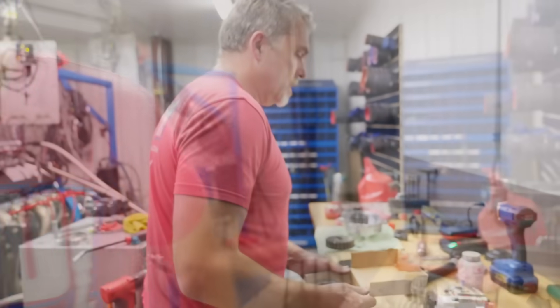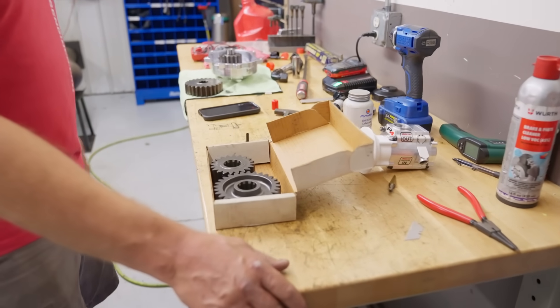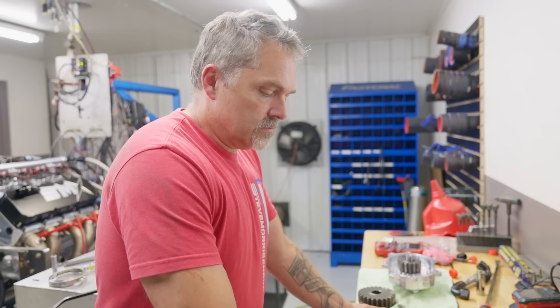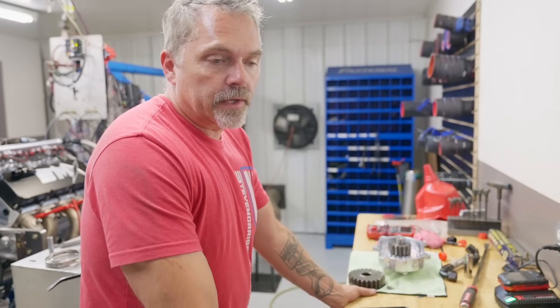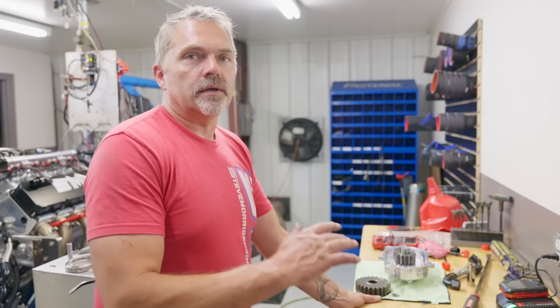So this is the gear drive and the gear set that's in here. Obviously it's spinning faster making more boost and driving up horsepower loss. So I'm just going to figure out our ratio — I can't remember what ratio I had in this. One, two, three, four, five, six, seven, eight, nine, ten, twelve, thirteen, fourteen, fifteen — 15 and 24. There you go: 24 divided by 15 — that's got a 1.6 ratio on it. Let me think about that, I've got some other ratios over here. My magic number is I'm just trying to make about 2,000 horsepower. I'm just going to change the gear set and drive — don't do anything else, nothing.